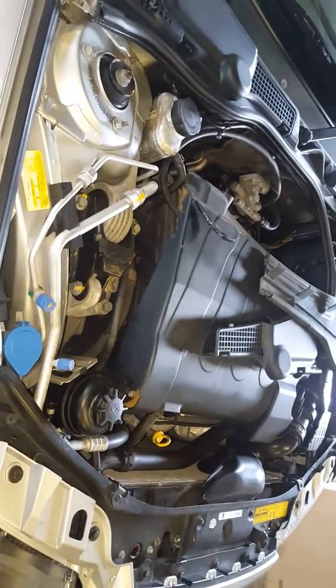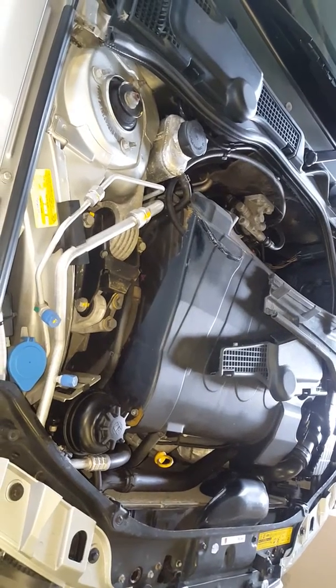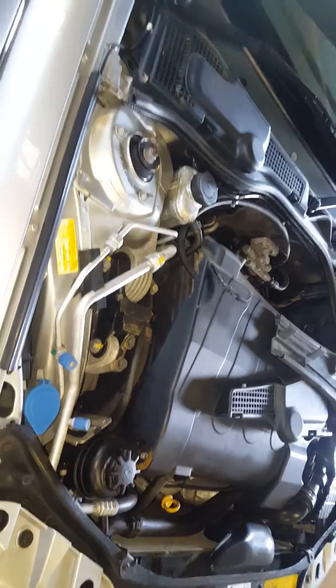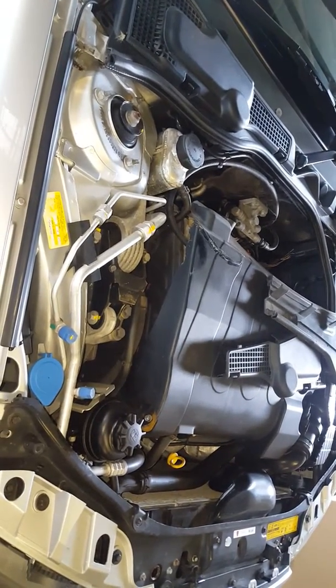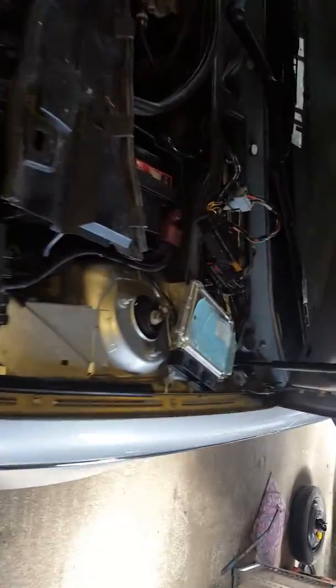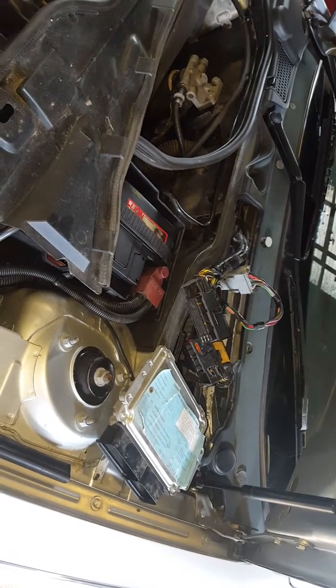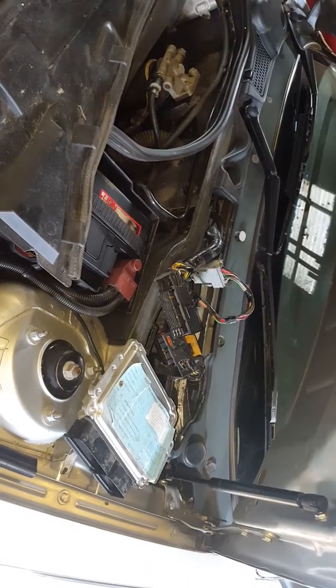I'm going to have to look a bit more in depth into the ABS system on the car, if there is one, and try and repair the dash loom, and hopefully we can get some revs and speed, etc. working again. I can't see it being too hard. I can work off wire diagrams for that ECU. I should be able to get the signals coming out of it for the different things, and I'm not too sure where it gets the fuel tank data and stuff from. I'm guessing it comes from the BCU.